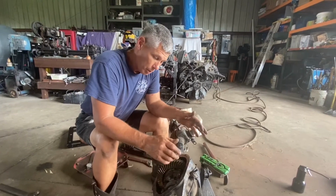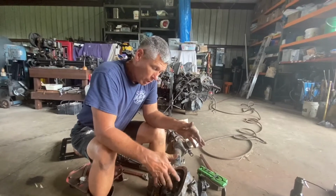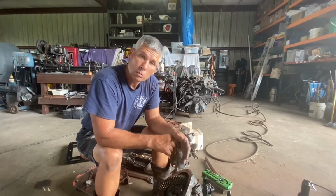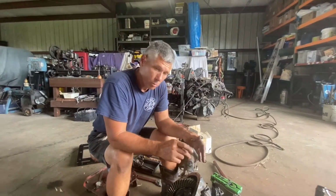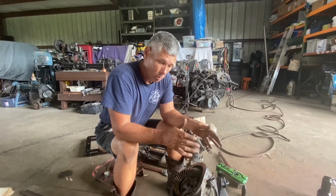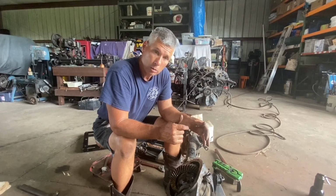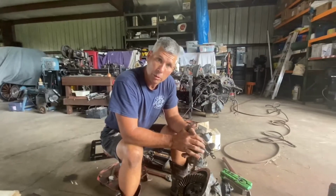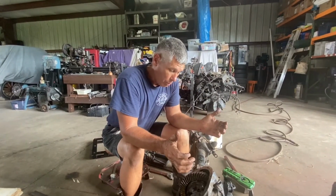back on. So we've got to press the bearings on the carrier and hammer in the inner pinion race and torque this thing back together, new seal, torque the yoke on, and this thing's done. Putting a cover on it and putting axles in it, it's ready to go. So I hope this was able to help a little bit.